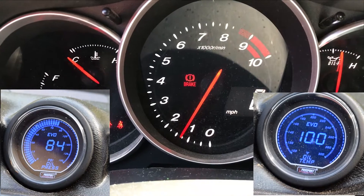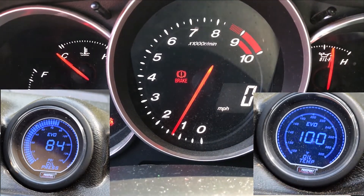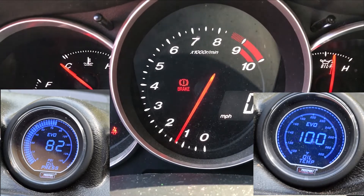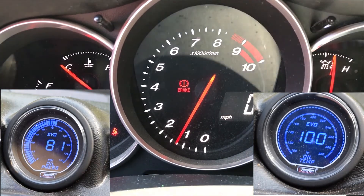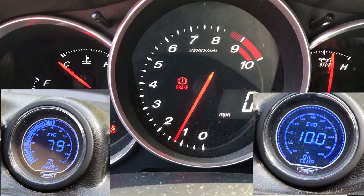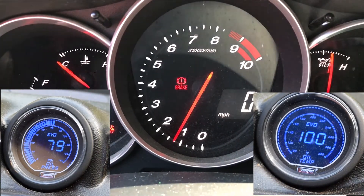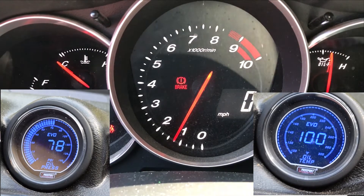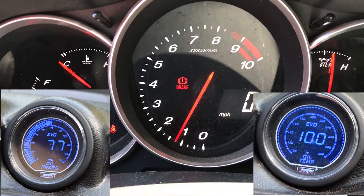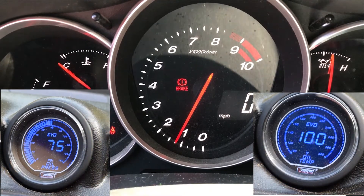As it warms up just a little bit more — this is still on the stock ECU on a street ported motor. We need to get the ECU tuned by Jason. You can see we're sitting about 80 PSI at about 1250 RPM. Eventually it'll drop to below 1000 RPM at idle, which is something we're going to fix with the tune. I want it to idle right about 1200 to 1250 constantly, so we're always pushing about 70 PSI.